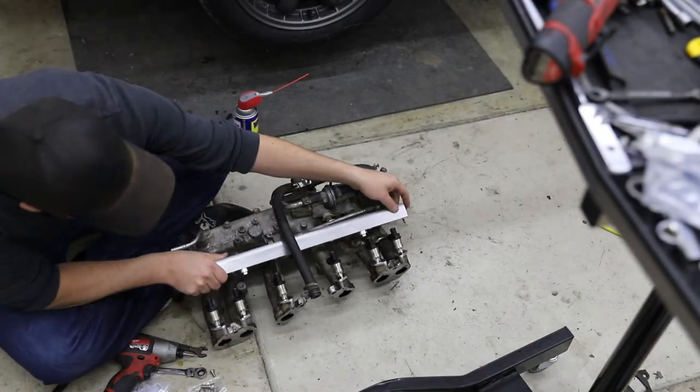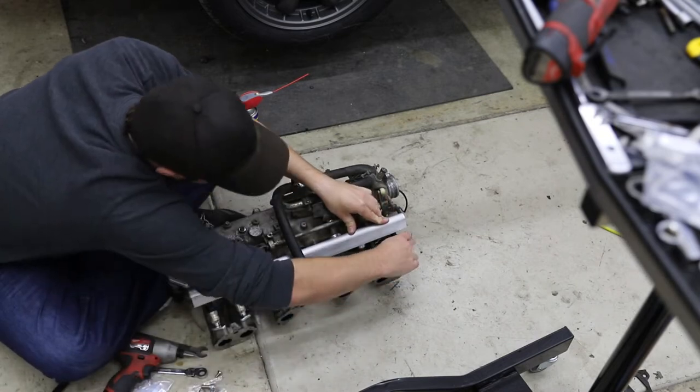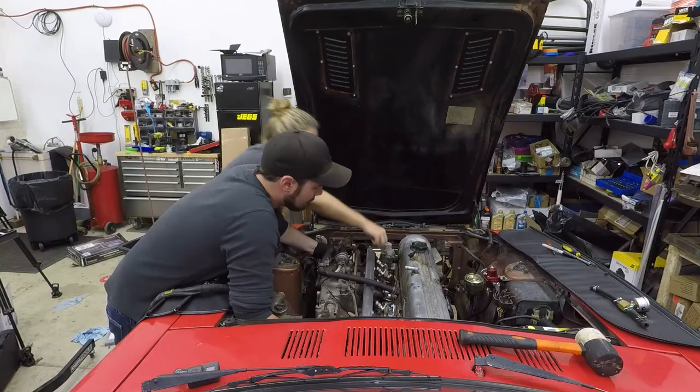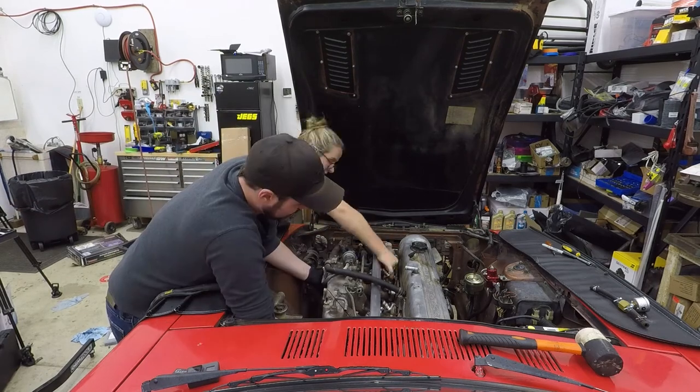When I got back, I finished wiring up power, ran the rest of the harnesses, kind of cleaned it up a bit, got the rest of the fuel system sorted. I also installed the new fuel injection rail and the new fuel injectors that are O-ring based, and I went ahead and dialed in the fuel pressure.